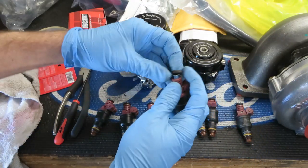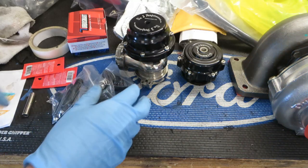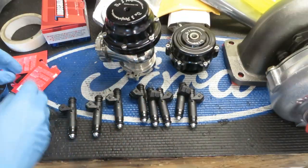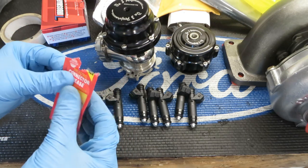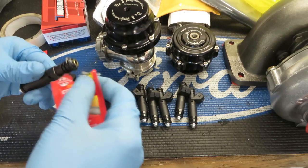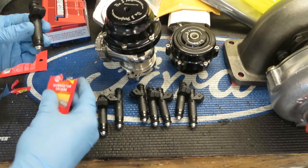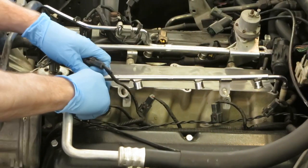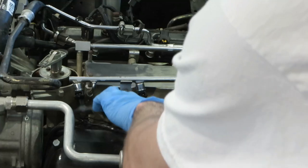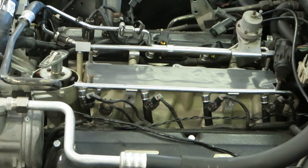We're going to keep these O-rings together so that way I can sell these to somebody else that might need them. As far as I know, these are working just great in the car and they're fine. Now to install the new DECA 60-pound injectors. Before we put the injectors in, I'm going to take a methodical approach here. We're going to put some dielectric grease on it - this is a silicon-based grease, which is what you want for fuel injectors. We're just going to put a little bit around the O-ring, one at a time. Just like that - pops right in. We're just going to go down the row, do each one at a time. Once you've got one side done, I'm going to go ahead and seat these into the intake.